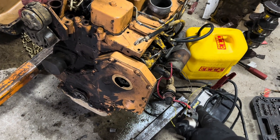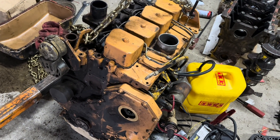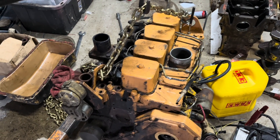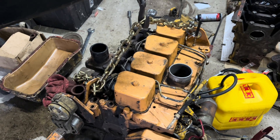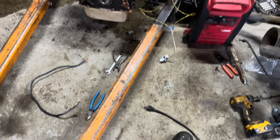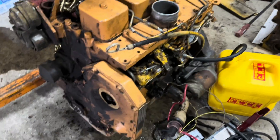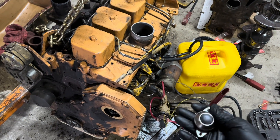That ground's questionable at best. It's not blowing around the injector now, but I'm still hearing a whoosh in the intake. So I may well still have a valve issue, but we might as well see what it does. Rudimentary ear protection. How much diesel in your ear is too much? Kind of smells like diesel oil too. There's no open holes to crankcase or anything. I didn't rack the injectors again — hopefully it's just bled.